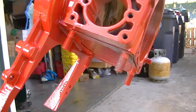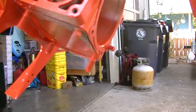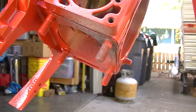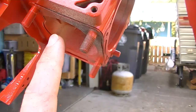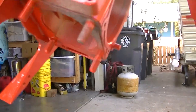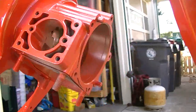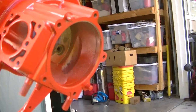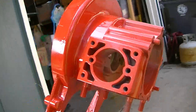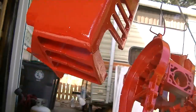I'll use some brake cleaner and a rag and wipe those down. Even critical gasket surfaces, like the head gasket, I will not paint. I left the old gasket in place to kind of mask it — I'll be replacing that. You don't want paint there. The intake's okay; it's not a pressure situation. But even on the side here where the crankcase gasket is, that'll get scraped down. Trying to mask it off and get it to stay in place is kind of a pain, so it's easier for me to clean it up.